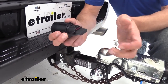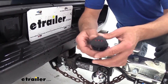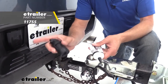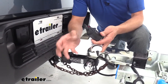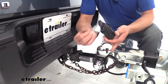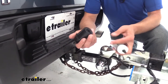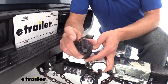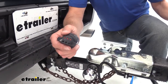You could leave this installed in the back of your truck if you don't use your 7-pole, but I recommend taking it out and throwing it in the glove box or something like that. We always recommend using dielectric grease, but if you're going to leave it installed, I highly recommend it. We're going to put that on both sides of our plug — it's going to prevent moisture from getting in. If we can prevent moisture, we prevent dirt from building up, and if we don't have moisture or dirt, we're not going to have corrosion. Corrosion on our prongs on both sides can lead to a lot of lighting failures on our trailer. Using a little bit of grease and keeping it on there is going to prevent most of that.